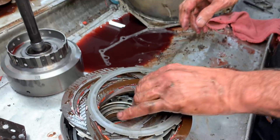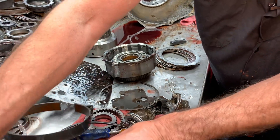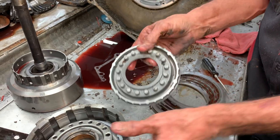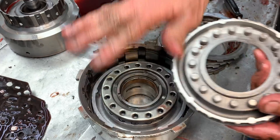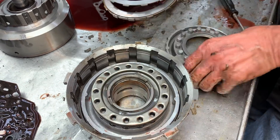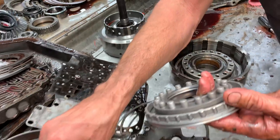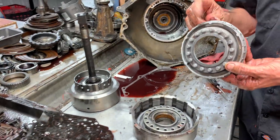On this part here we'll take and add another clutch — that's the drum right here. What we do is we take and shave these pistons down to 125 thousandths and then we'll put this in here, take this piston out, and now we add one more clutch. Instead of having four clutches we'll get five clutches in here now by shaving this piston. That's a must on a 350 because third gear is the weakest link in this tranny — so you always want to do that on every one you do. We take about five or ten pistons down to have them machined at a machine shop.